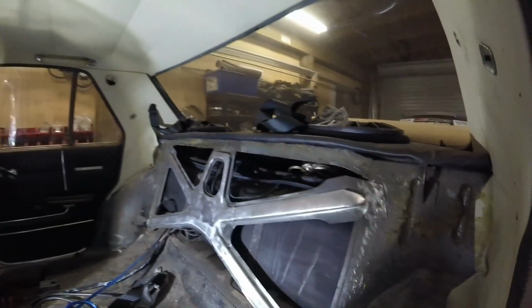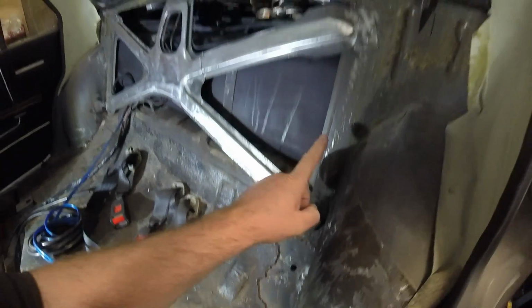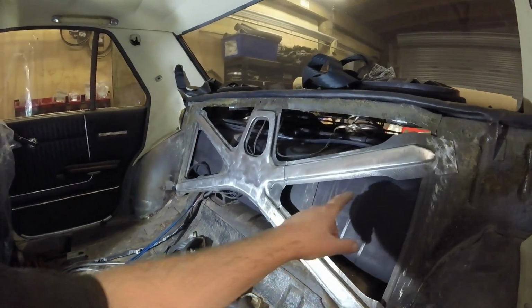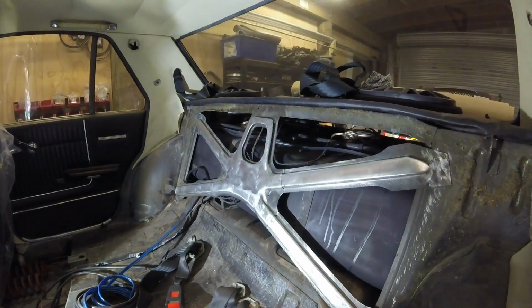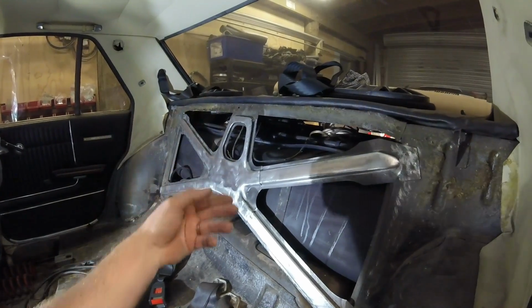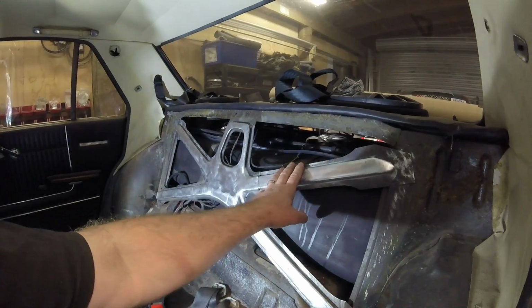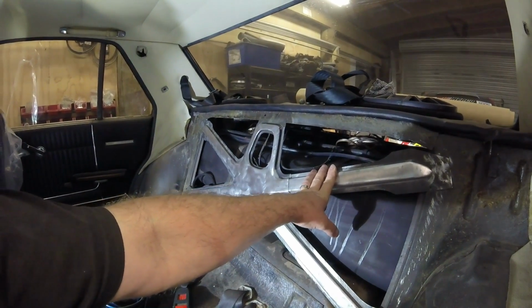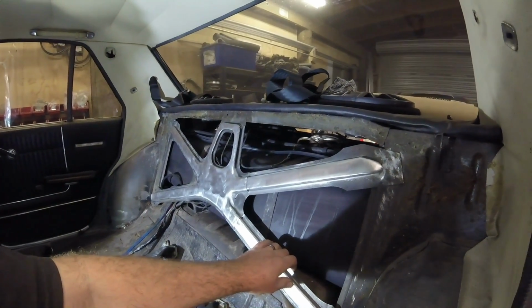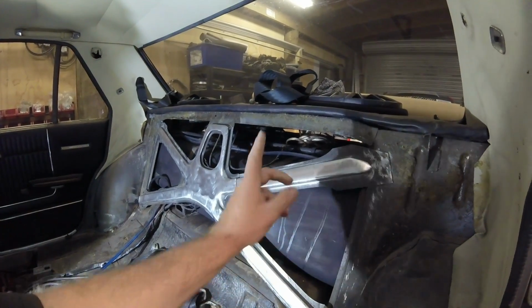Alright, so with the rear wheel arch solution being put off until a little bit later on, till we've got our diff and our wheels, to make sure everything's going to fit there without some mods. We could do those mods while we're repairing it, you see. Next thing that I can do in the general area, actually very close, because we were literally working here, we can work here. This area has to be sealed, and I use that term a little bit loosely, off from the fuel tank and everything, because we've done some, let's call them modifications, to the fuel system. We've added a fuel pump and filter and some lines and a surge tank in the boot area of the car. We now have to seal the boot off from the cockpit area, or the cabin might be another term for it. Basically, it's not really to stop fire, but I think the general gist of it is to prevent the splash of fluids, etc., from that area into this area.